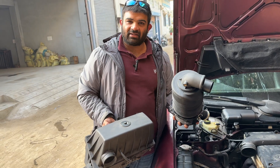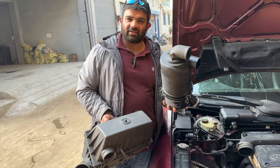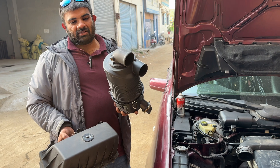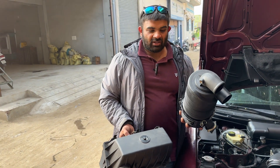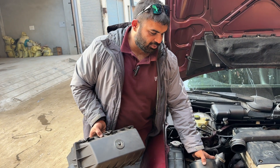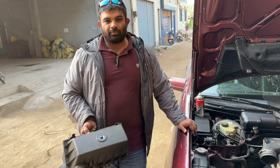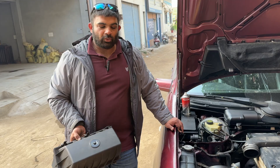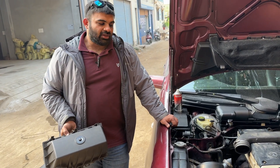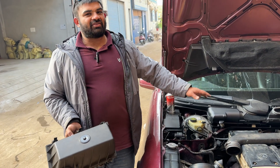This is their tried and tested option. It runs with two filters but we'll be taking out the inner filter and running a single filter. They have flow matched and flow tested it, and he's more than satisfied with the performance. They are installing a big number of turbos on tractors, and the pump is pretty similar to the Bosch units on tractors these days — they are very well versed with what they are doing. It is just a similar setup but in a different vehicle.